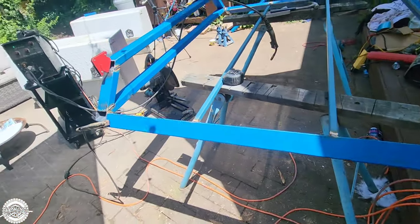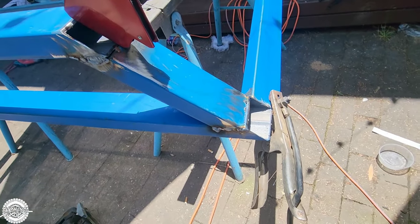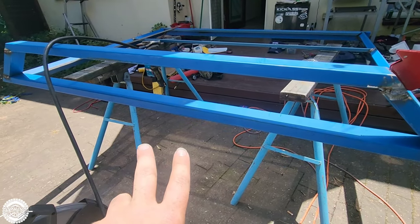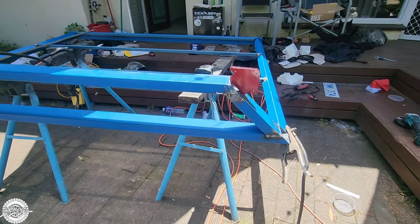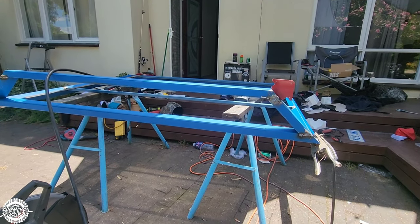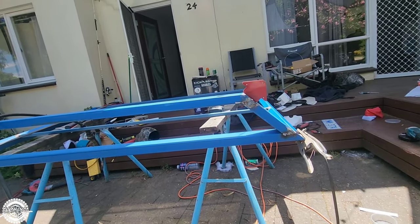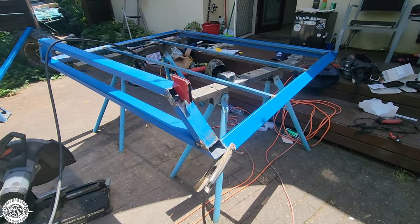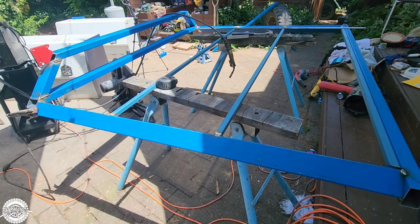I'm back with the welding gas. I kind of went ahead without filming. All those ends will be capped. The tray is actually upside down at the moment. That section is for the number plate and lights — reverse, brake, tail, whatever. On the inside there will be sheeted, and we'll basically mount all that to that, so the lights are actually tucked in 60mm, so they're pretty well protected. This is essentially identical to the last tray I built for the single cab — if you've seen the old videos you would have seen it.